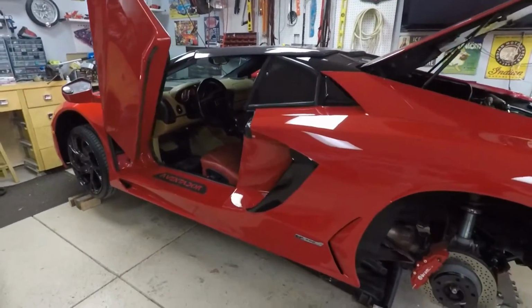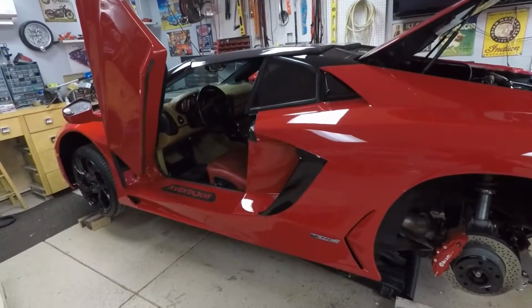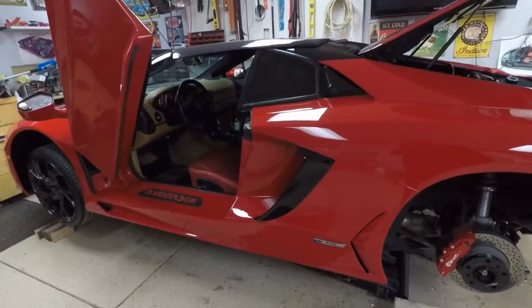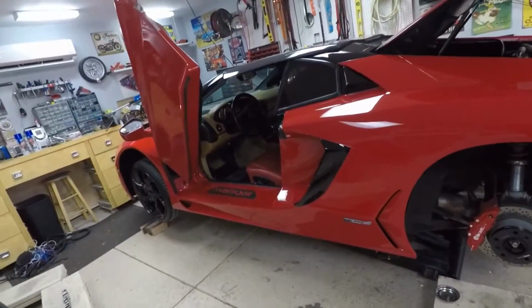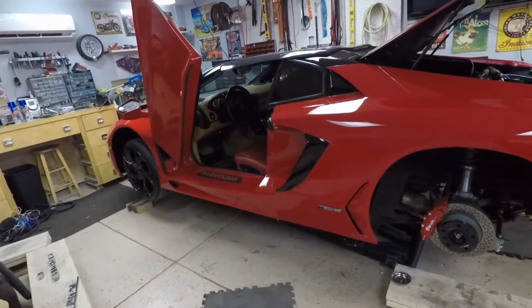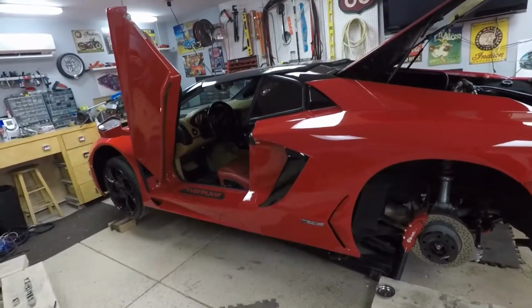And surprisingly, that was my problem. That little wire is so basic and generic you wouldn't think it does anything, but it definitely fixed my problem when I replaced it. So that's the first thing. No matter what everybody on the internet says, the first thing I would do is take the gas cap off, push that little flap in, and listen for that clicking noise.